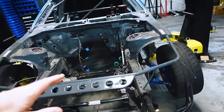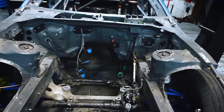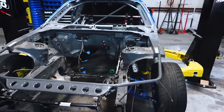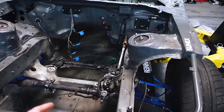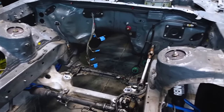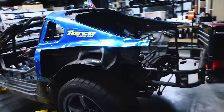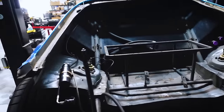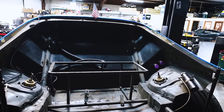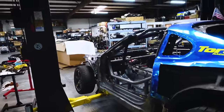What I was thinking I should do today is disconnect some of the fuel lines that are still in the way and the steering column, drop the front subframe, and do something with the brake calipers. Then I could get it ready to clean up. If I'm gonna work on the rack and whatever else, it'd be easier if it's out of the car — clean it up real nice to go back in. And possibly do the rear as well. I'll probably take the whole car outside and clean that. It's been really cold so I wasn't wanting to work on it.